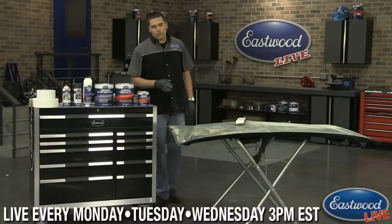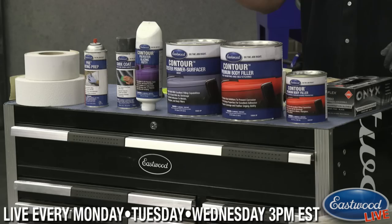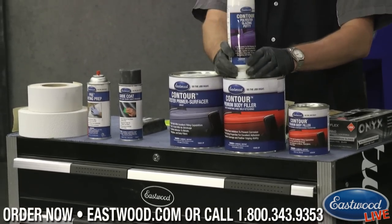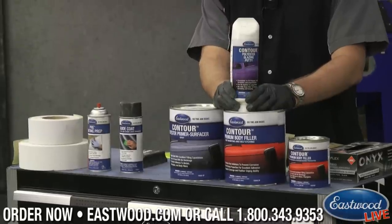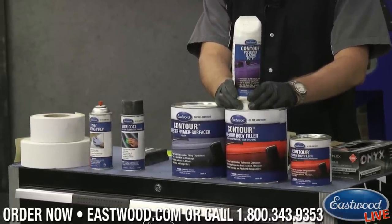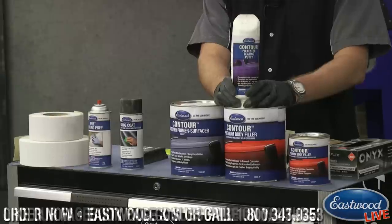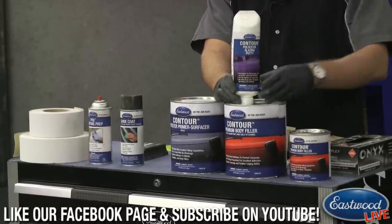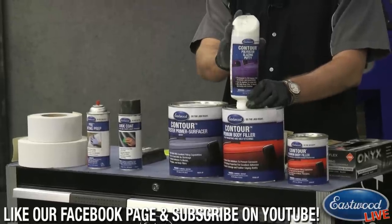There's two ways you can move from here. One option is you can move on to our contour glazing putty. This is going to be a lot like the body filler, except it's a lot thinner, a lot runnier, and it's designed to fill anywhere between 80 and 120 grit scratches. So if you take that to 80 or 120, this is going to be a perfect product.